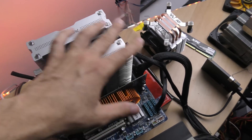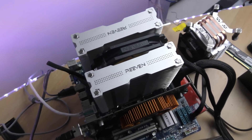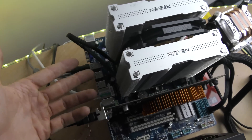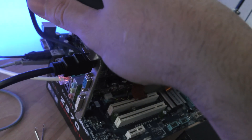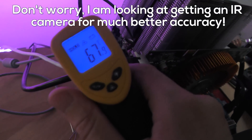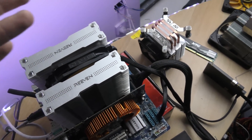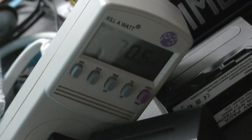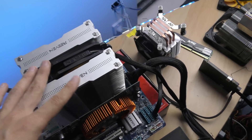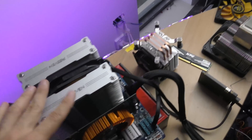I've just finished two rounds of testing now with the TX3 and the Riven Cooler, and the Riven Cooler did do a lot better than the TX3. However, I would have taken the CPU to 3.8 gigahertz, and I did get it to 3.8 gigahertz, but it's really not sustainable on this motherboard. Even dropping it down to 3.6 gigahertz after 10 minutes showed that the VRMs on the MOSFETs were measuring at 68 degrees from an IR gun — and that's really hot. Even the chokes, when I was touching them, they were getting extremely hot too. So something like this motherboard isn't geared up towards overclocking that much. So 3.6 gigahertz is a happy medium, and even then it was putting out the CPU around about 70 watts. So the CPU is running a little bit hot, even at 3.6 gigahertz. For the apples-to-apples-to-apples test, you can see that the Riven cooler, even though it's massive, is doing a better job than the TX3. Now it's time to whack on the silicon gun cooler and get the final results.